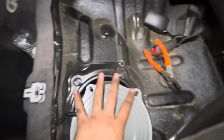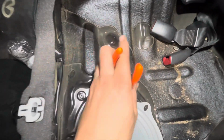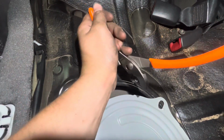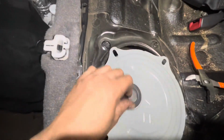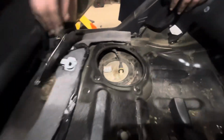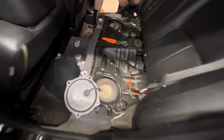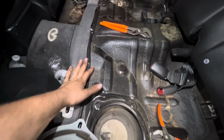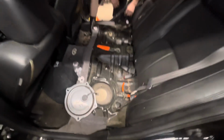Here you go, Ty. So, scratch the Phillips screwdriver. Use pliers and just pinch down on them and move the tabs 90 degrees so you can slide the top hat off. And now you are exposed to 1 connector on the driver's side and a fuel line and a connector on the passenger side. And yeah, so then I'm pretty sure that'll be everything up from the top. We will double check to let you guys know, but yeah, so far so good.